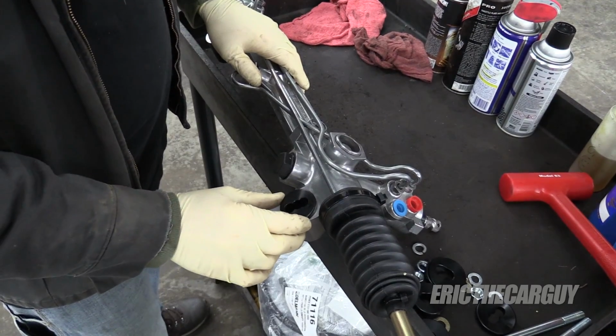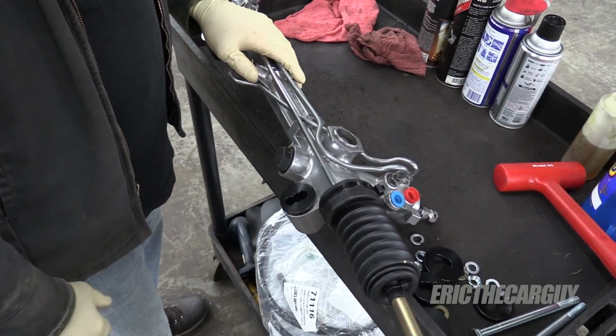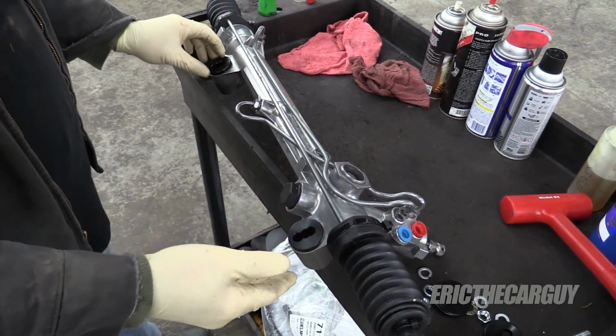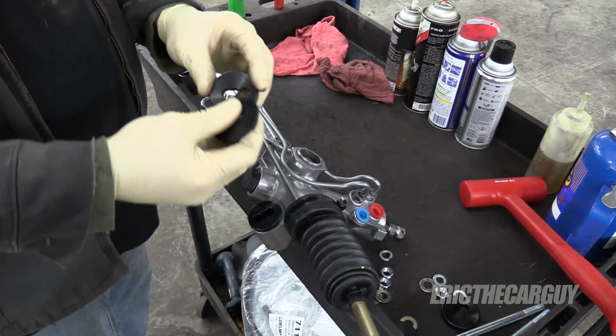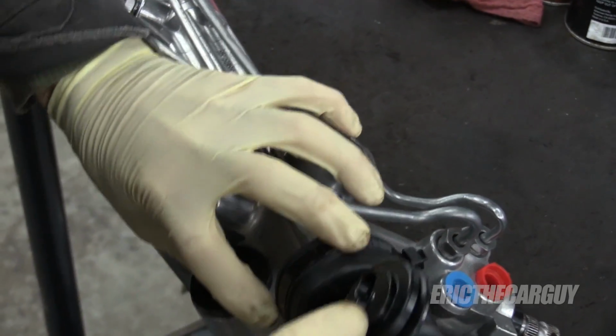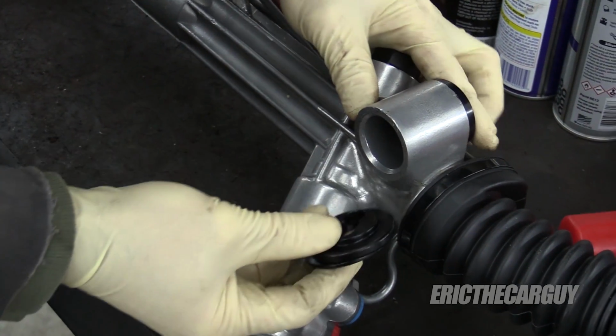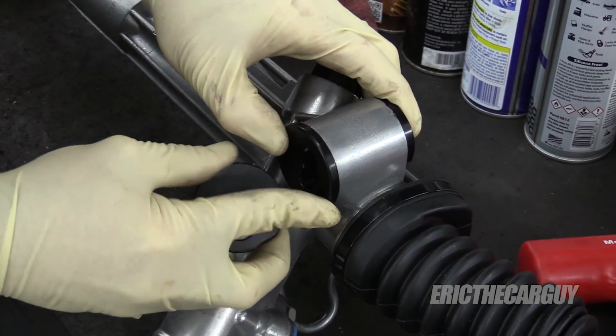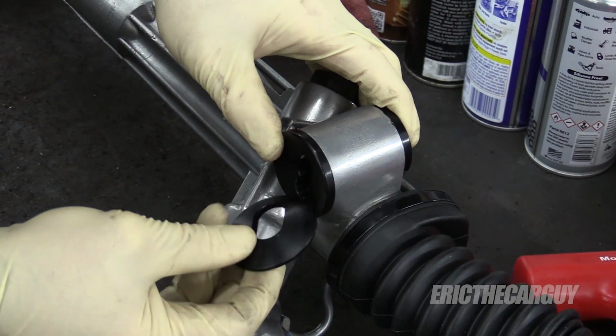These bushings go in place of the rubber bushings, and Maxima Motorsports recommends that you mount this as high as possible onto the K-member. Then on the back side, this will be like this. So I will put this back here in like this, so this doesn't move around.